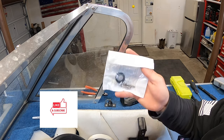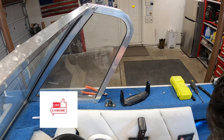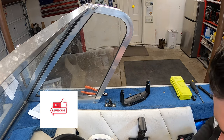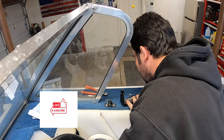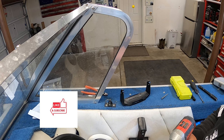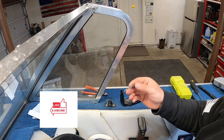Humminbird display with the mounting screws, so there's just four Phillips head and a little grommet. You want to route the wires through that once you drill a hole. So just drill an 1/8 inch pilot hole, and then those screws will go in just fine after that.